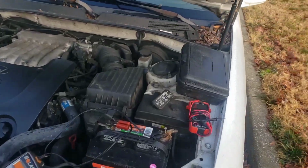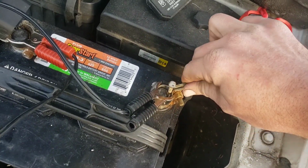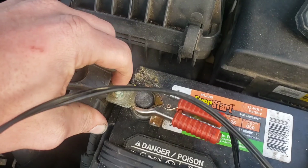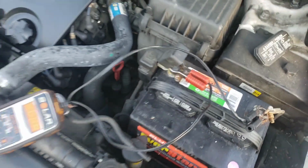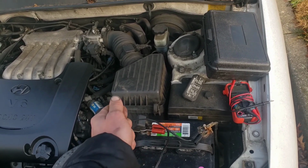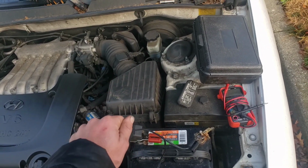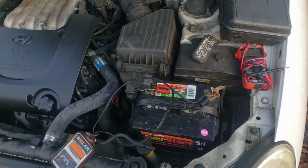You can also grab a hold of the connector and try and spin it. This one I had to kind of just stick it on there, so when I would, it'd be on there good, because the connector is also broken on this one. This one you just try and move it, and if you see it move, like this one's moving right here, that's also a good indicator of a no start, because if it's not on there tight enough, it'll lose the connection. A lot of times what'll happen with something like that, you turn the key and it'll go click, and then all your power will go out. And if you come out here and twist it, all your power comes back on. You try and turn it again, it either tries to start or it'll click and do the same thing again. So that's what's kind of going on with that.